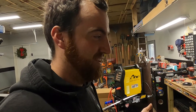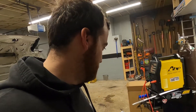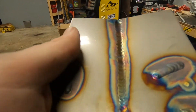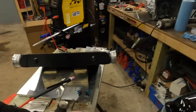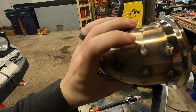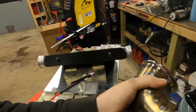I'm pretty proud of myself. The stainless stuff has been coming along pretty well. This is a butt joint — two pieces — look at that weave. I wanted to practice on pie-cut pieces, so I did tack up the downpipe top section of my turbo setup. I'll weld it with you guys on camera. The fit-up looks good enough that I might be able to do an autogenous — no-filler — weld, which would be really clean.